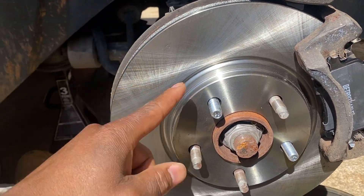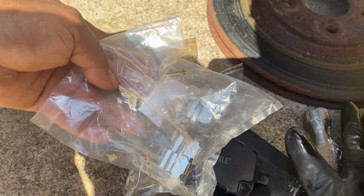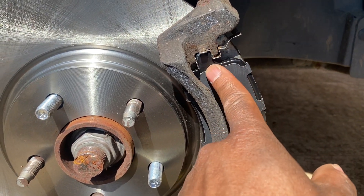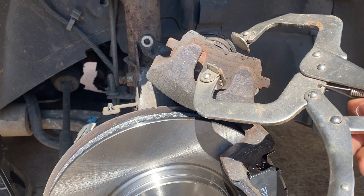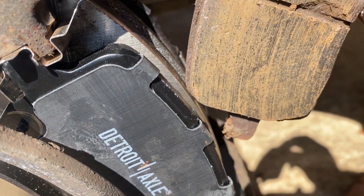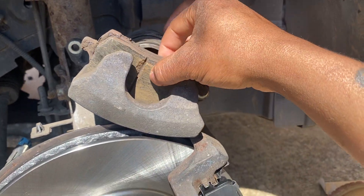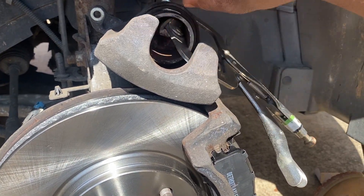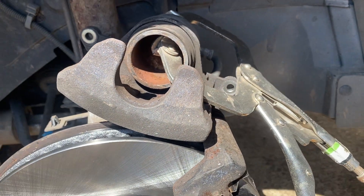All right, the rotor is on. Once you tighten up the lugs, put the rotor on. The brakes come with some new clips - there's a little step right here, just remove them. It's pretty much self-explanatory: put them into place in the caliper, slide the brake pads into the channels. For the brake caliper you gotta push the cylinder back in because the new brakes have way more meat than the old brakes. I've seen screwdrivers, clamps, clamping pliers used. I put my clamping pliers in the hole and squeeze. On some cars you gotta use channel locks and twist the caliper all the way back in.